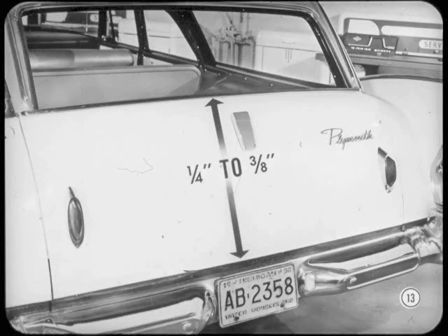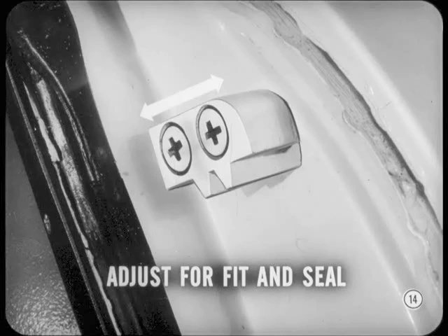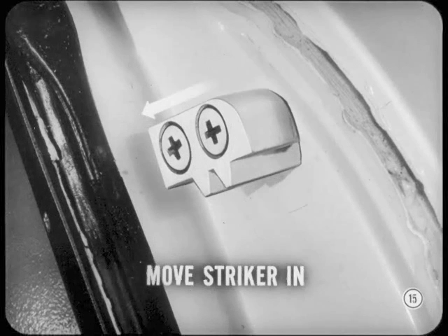Aim at the best possible fit so the gate will latch correctly and won't leak. Except for the striker adjustment — you adjust the strikers for a flush fit with the panels and for a tight seal against the weatherstrip. Don't move the strikers in too far, or the gate will bounce back without latching. Here's where patience counts. Move the striker in far enough for a flush fit and consistent latch engagement. Close and open the gate as a check. You may need to move the strikers more than once.